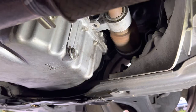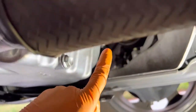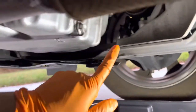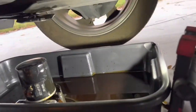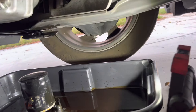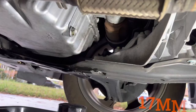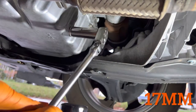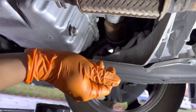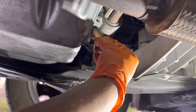So this is the oil drain plug. You're going to want to position your oil bucket further back because once you unscrew this drain plug, it's going to shoot out in a very long arch. Make sure you give yourself enough space so you don't miss your bucket. Grab a 17 millimeter socket and undo this drain plug. Go ahead and undo the rest of the bolt by hand and pull away quickly.